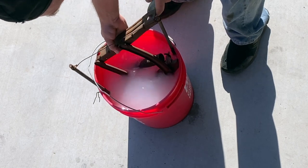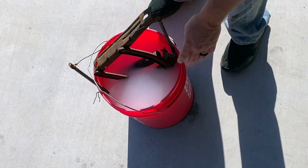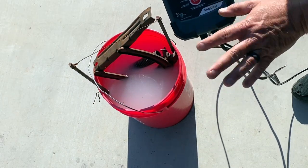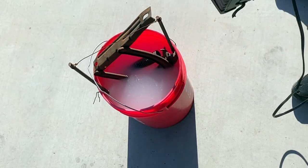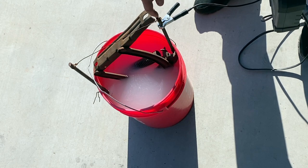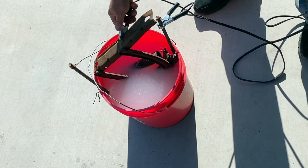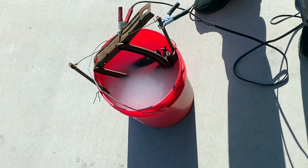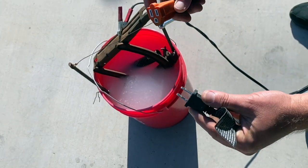As you can see it's not quite going to fit all the way in there, so we'll have to do half and half. Next thing you need is just a simple battery charger — even just a little trickle charger. Take your two leads: put the negative onto the pole there, and take your red positive lead and clip it to there, so it all comes together. Now let's plug this in and see what happens.